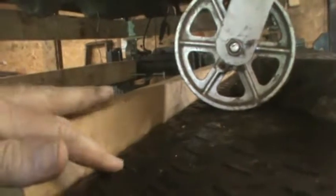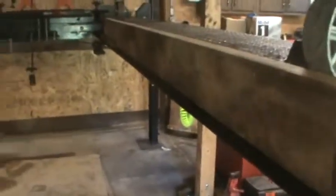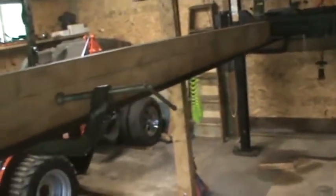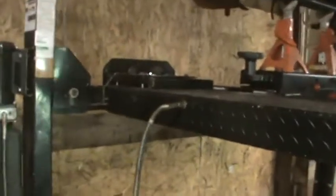I was able to take the chassis and roll it off the lift and roll the body up onto the lift so I could work on getting the rust off the bottom. The dolly has casters, so I put these two rails here that are higher than the lift so that as I pulled it on I didn't have to worry about the casters coming off. I lowered the lift down — not all the way, just to where it was just about to touch the clamps on the ground. I then took out the backhoe and opened the back door of the shop.